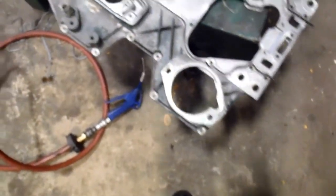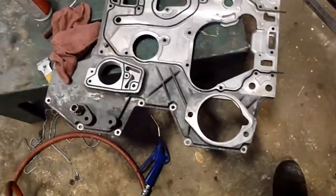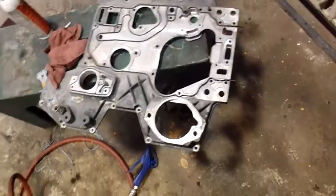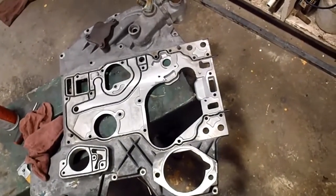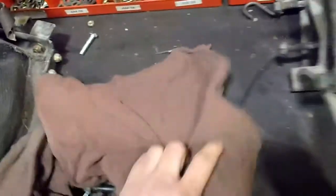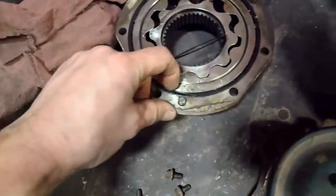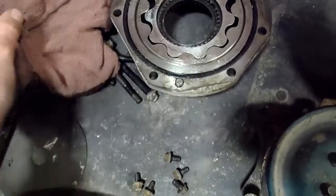But what it's missing is the compressor O-ring that goes in there. It's missing the high pressure oil pump O-ring that goes in there, and this is all stuff that you have to take apart. When I order a gasket kit, I expect to get everything that I would need, and this one doesn't have it. It also doesn't have the crankcase front main seal that goes in the front of the oil pump housing there. It's right here. It doesn't have that seal. So it has the O-rings. I better make sure, but I'm pretty sure that it has the O-rings to seal the oil pump here. Right there. I'm pretty sure that's what those big quad rings are for. So why would they put that in there when they know you have to take that apart and not put the front crankshaft seal in?